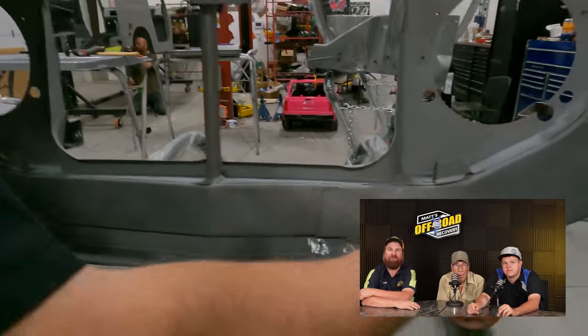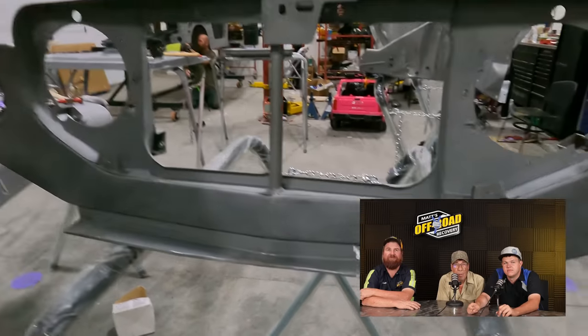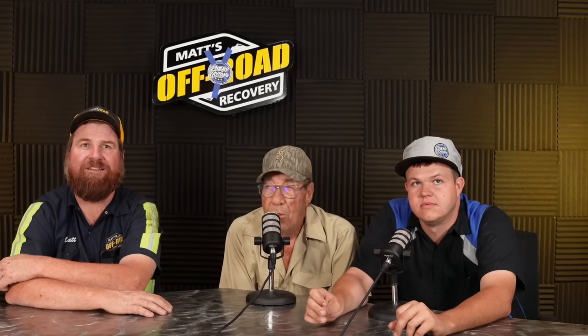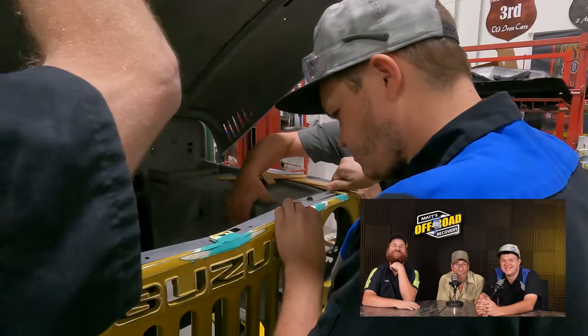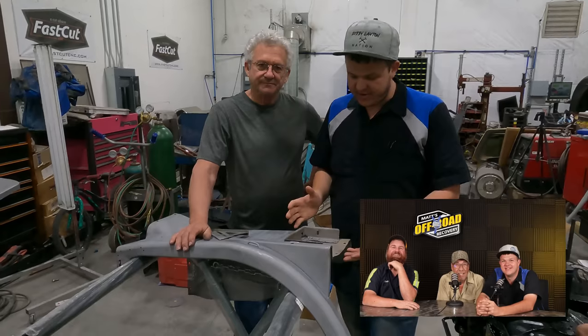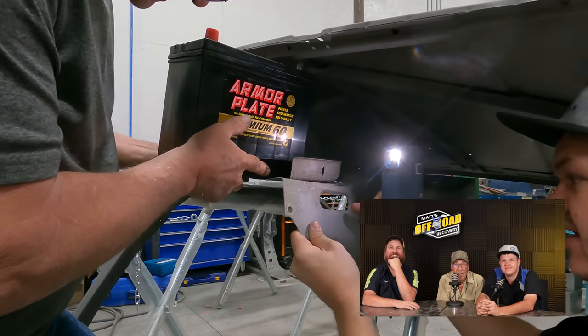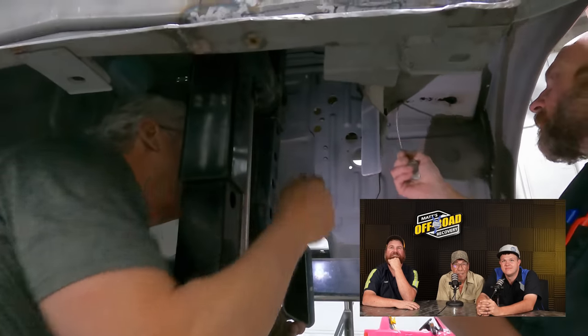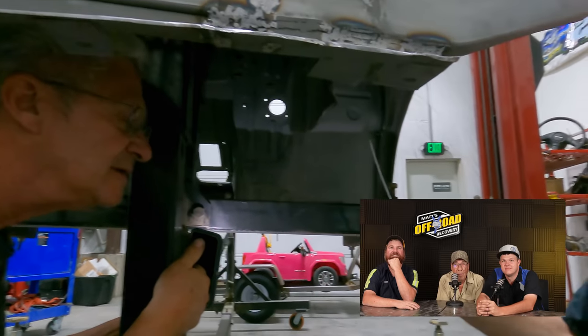Check this out — got my metal back where it needs to be. We've got some spots we're going to have to beat out by hand. We're going to fit the grill. Look at that gap — perfect. That grill looks pretty good. We're going to be building the battery box. We need to recess that thing down in here — about eight inches, battery can't be more than six and a half tops.